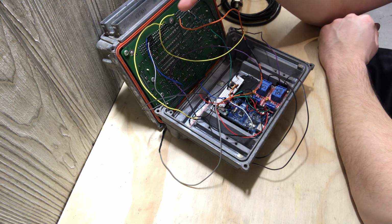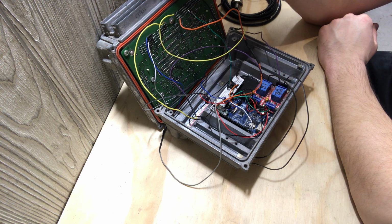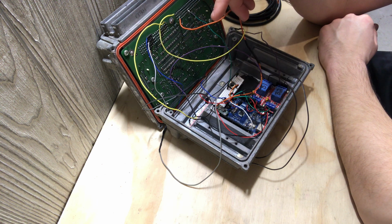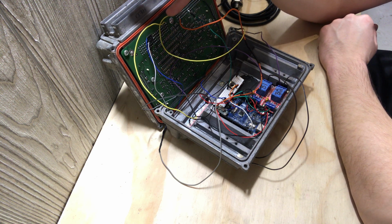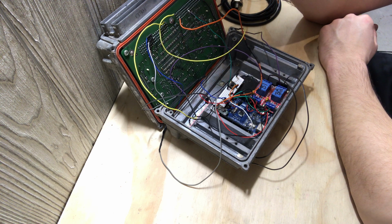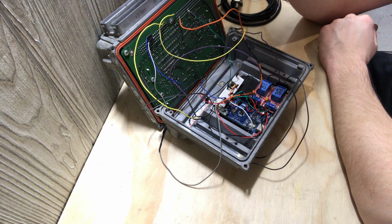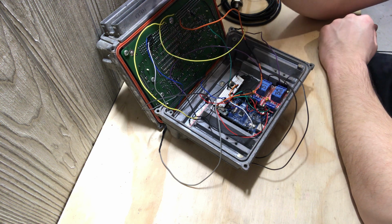There's 8 of them, obviously, one for each coil. And instead of it doing 8 low references back to the PCM, it does 2, and it's based on banks. So it'd be the left bank and right bank. The driver's side bank would be cylinders 1, 3, 5, and 7. The passenger side bank would be 2, 4, 6, and 8.